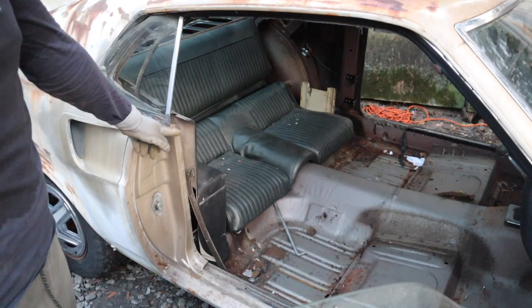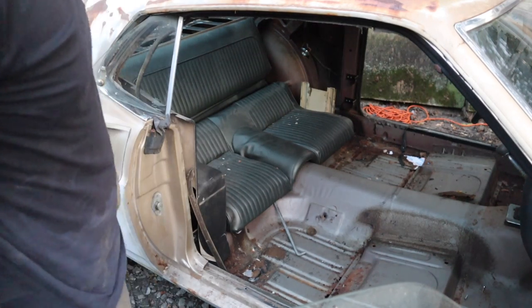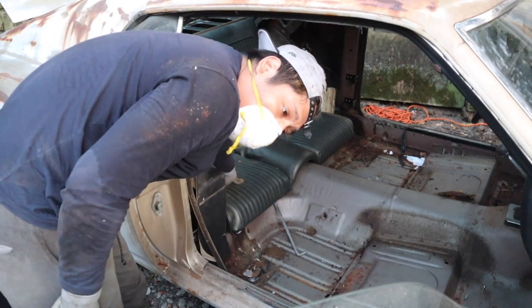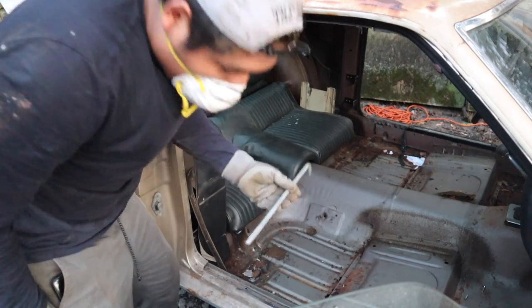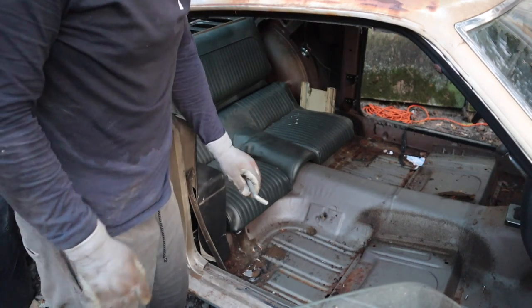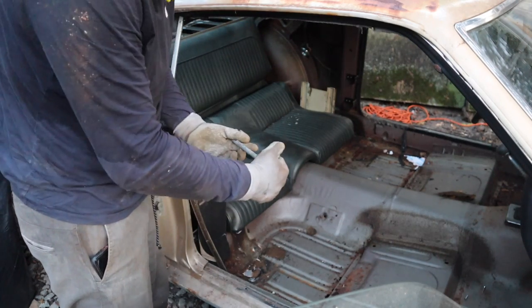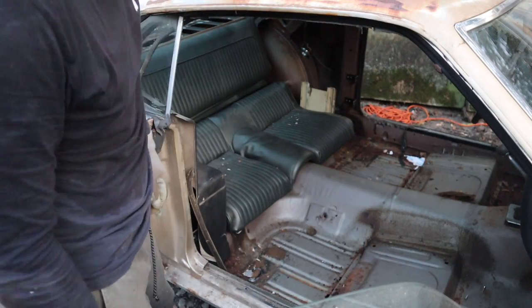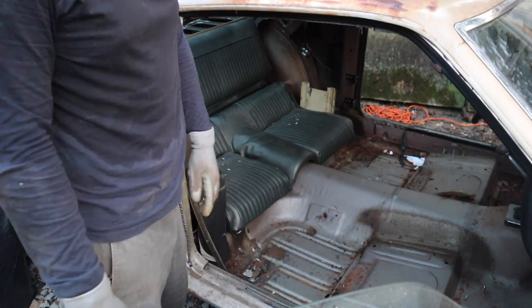These rear seats were the worst rear seats I've ever had to take out. They have two hooks where you're supposed to fit a flathead, or whatever you have, to push a little thin pin hook back and up, one here, one on the driver's side. And once you get those out, then you can get the rear seats out.